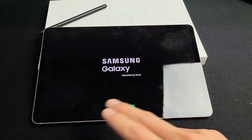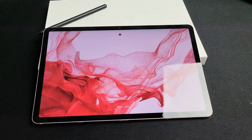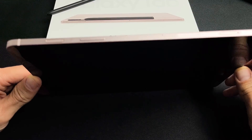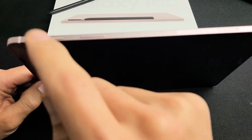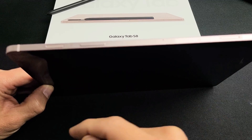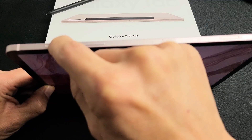If you're still stuck in a boot loop, we're going to go to the next possible fix. So the next possible fix — first thing, go ahead and grab your tablet. We want to find the power button. What we want to do is spam the power button — press it in and out quickly. So here's the power button. In and out like this.